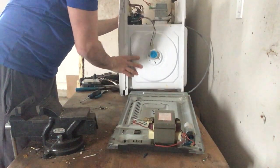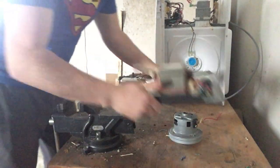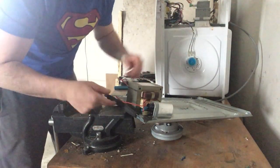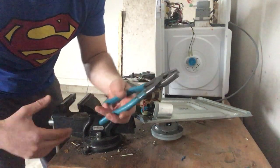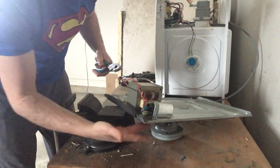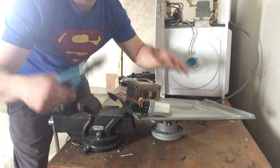After I took the top off, I removed the screws on the bottom. I'm going to save this metal plate for later because I'll put it right back on. There is my capacitor — it's always connected to the magnetron with some cords or cables. I cut those. I always want to use rubber-handled pliers or cutters to ensure maximum safety. The capacitor is held in with a screw or clamp that keeps it down to the frame. I'm going to pull the cables off and the connectors. I'm not saying there's any charge left because I've left it sitting, but I don't want to take the chance.